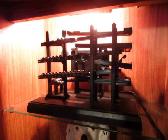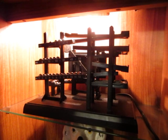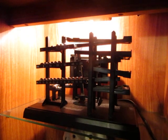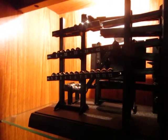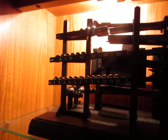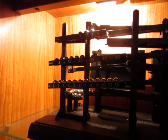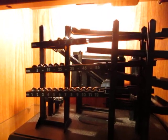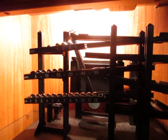This is of course the British version for 220 volts. It just tells the time with a set of balls on plastic tracks. They are lifted up by a plastic arm fixed to a synchronous motor which advances one minute at a time. Single minutes are measured at the top, up to five. Fives of minutes are measured in the middle and hours are measured at the bottom.